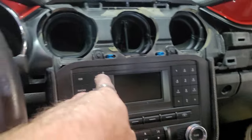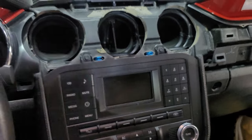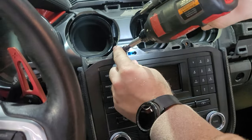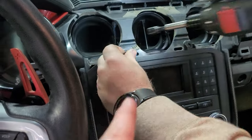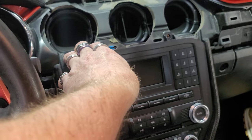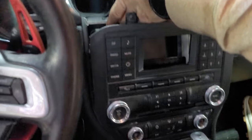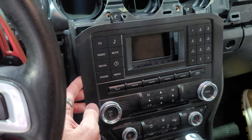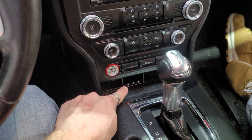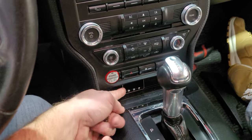Now the next step: I believe these are 7 millimeters and these two bolts have to come out — that's how we get this radio out. We've got a 7 millimeter here and a 7 millimeter right here. Don't drop the blue clips down the back of the dash — we almost just did that. Then you pull on this and you don't want to break anything on this extremely expensive radio. That bad boy will come forward and down here there is another screw we're going to have to take out.